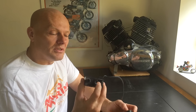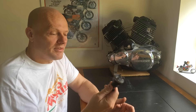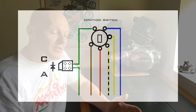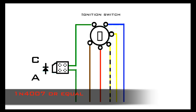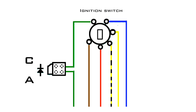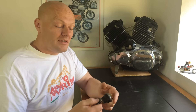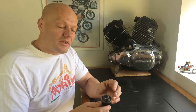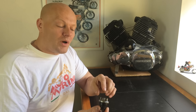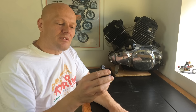So never put 12 volts directly to the ignition boxes. There is a precaution you can take to avoid frying your boxes if the main switch fails — it was actually introduced on later bikes and it's simply a diode in series with the green wire. So if you have one of the early bikes without the diode you may want to consider introducing this diode to your wiring. In some cases the main switch will connect the green wire to ground permanently regardless of switch position. If you think you have that problem, you can simply disconnect the green wire that comes from the main switch at the fuse box — if the bike then runs, it's the main switch that's causing the problem.